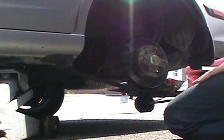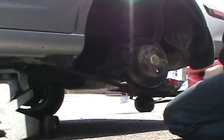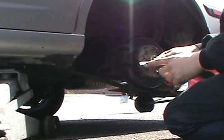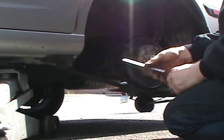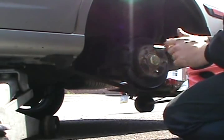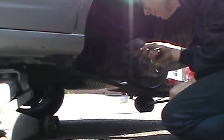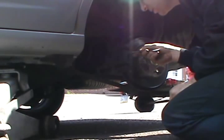If you're getting ready for inspection and you're wondering how the auto tech is going to measure your brake pads, this is how they do it. A lot of them do it in 32nds. You want to get yourself a ruler that reads in 32nds. Push it up against the rotor and measure your distance between the back plate and the rotor.